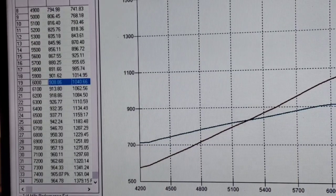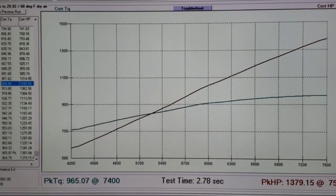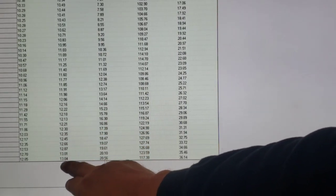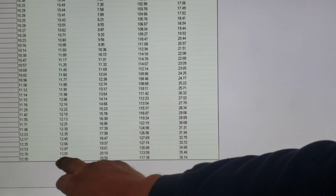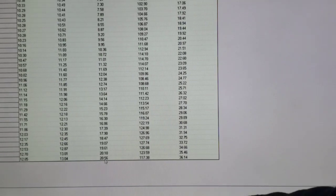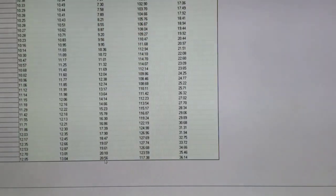So that's on the race gas tune. Now let me show you what it made on pump gas. The boost was 20 pounds — 20.1, 20.5, right in that range. There are a couple of spots where it just gets up there a tick. We could probably put a little bit more fuel in it right there. We also pulled a little jet out at the very end on this last run — just working on that fuel curve. That all looks really good.